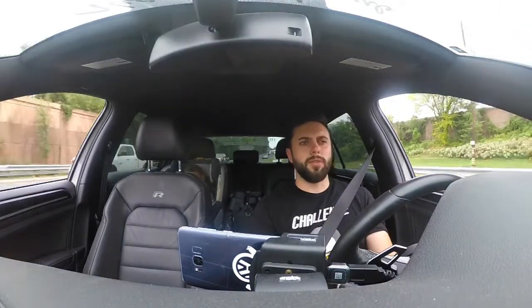So I ran through all the gears and discovered that it was definitely getting leaner at a certain point, but once it was just roaming through the gears, it wasn't leaning out. At one point I thought I was hitting 16, 17 AFRs, which is terrible. You're running the risk of leaning out the engine and frying something, so I was worried about it. I asked George if there was something I could do with the fuel bias to account for this, but he had me go out and try a few more logs, do them a little bit differently, and come to find out it was really just a spike due to the sudden slam in throttle at one point.